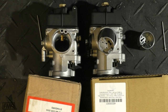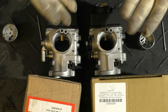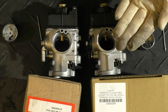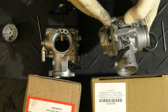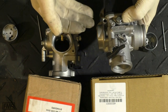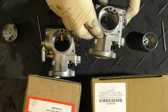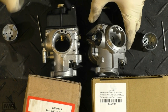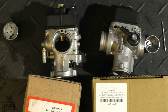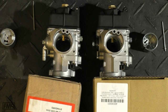Be patient — you will find them online. I'm not saying the replica doesn't work; I'm just saying it is definitely lower quality than the Dellorto. Why save 20 euros and risk the hassle? I also got a report from a Facebook post that the overflow drill on the choke was drilled through and sucked air — I can't verify that here because I can't get the choke out. It also matters how good the bores are, whether they are clean and have the right diameter, as that defines how well a carburettor works. Dellorto is definitely better.